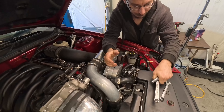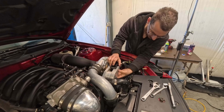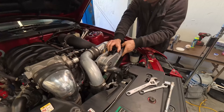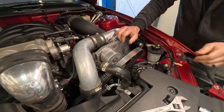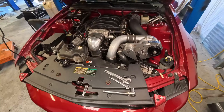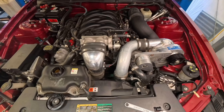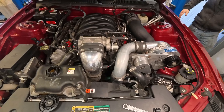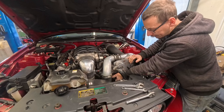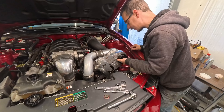So that's loose. Take this belt off and then we'll see if we still have that noise. Needs a new belt anyway. After removing it - it sounds pretty quiet to me. So it definitely is ProCharger noise.